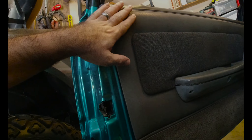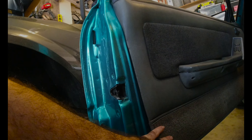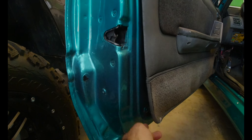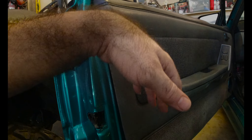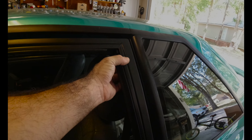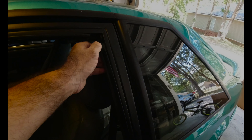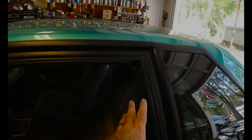There's actually nothing wrong with the vinyl on these door panels — the carpet at the bottom can be cleaned up and straightened out. The reason the door panels bow out is because of this backing — you can see it's all rotted and messed up back there. That backing is only about 30 bucks. And here is where the run channel moldings go — you can see this stuff is just shot. That's your run channel molding right here, we'll replace all that.